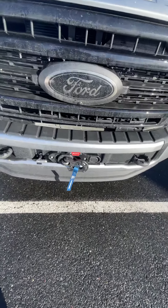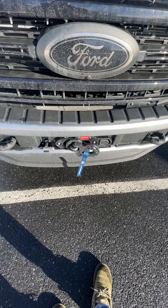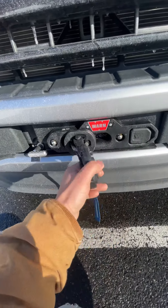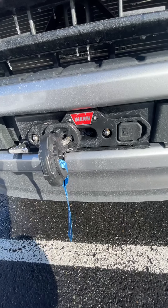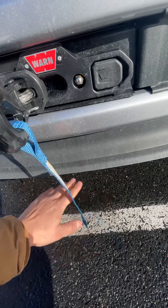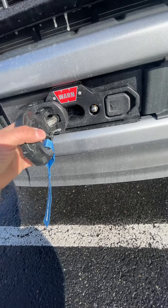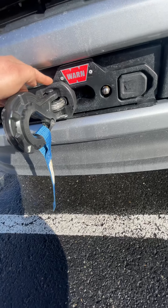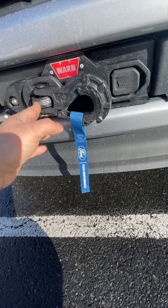The drawbacks are that when you pull the rope in, it'll tend to jam up the next time you use it. It's not jamming while winding in — it's that when you flip the clutch to free spool and try to pull out the rope, it wants to be stuck. I'm not sure if that has to do with the size of the drum and how much rope there is. I now have the two splitter bolts completely out and haven't really experienced a jam. I'm also not running the cover anymore — I picked up an isolator from AEV instead and just pull the rope in all the way so there's not too much exposed rope.